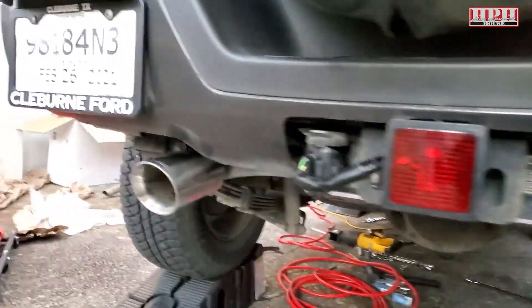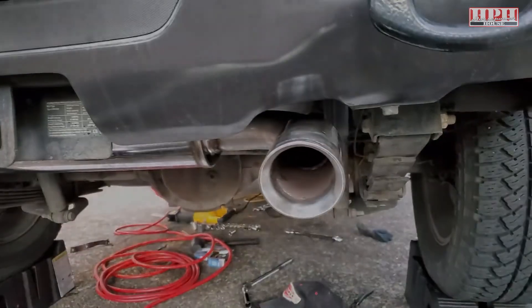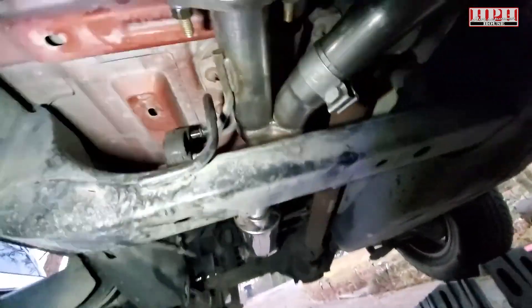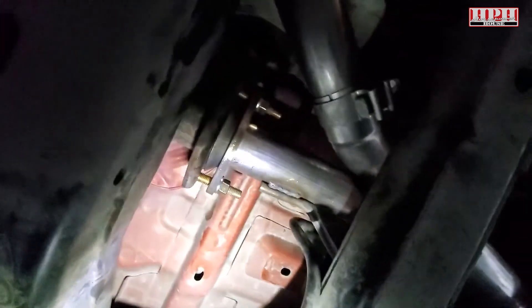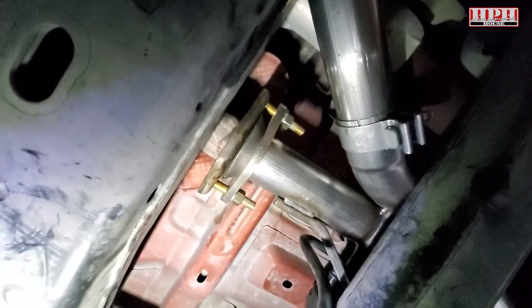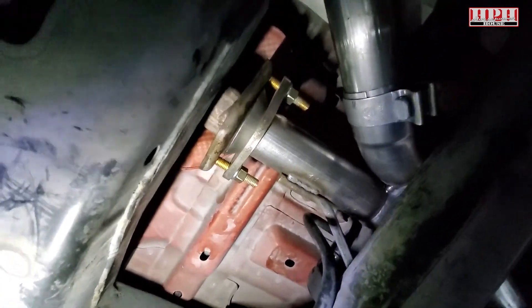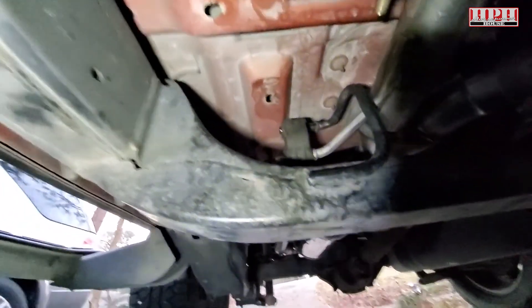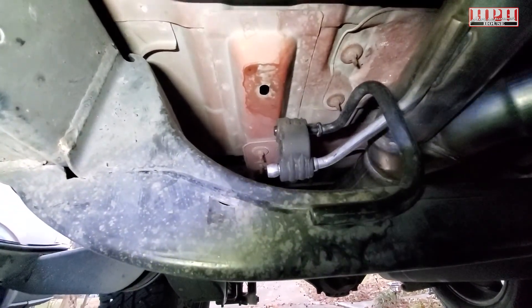The exhaust tucks under right there and those little dips on the bumper look like it's factory. A few notes for installing on the Hummer H3: I had to actually cut the bolts off at the flange where it meets the existing exhaust — there's no room to fit a wrench because the bolts were facing the other way. I had absolutely no room to get torque on those very crusty bolts, so I cut them off with the electric hacksaw and faced the new ones toward the back of the vehicle for much easier access.